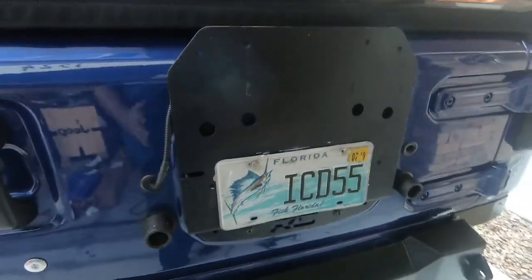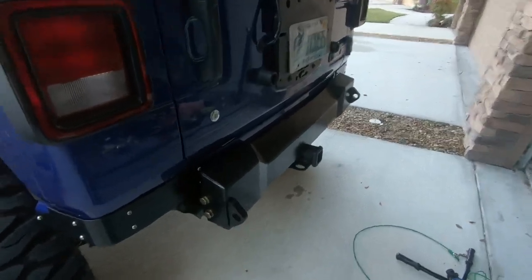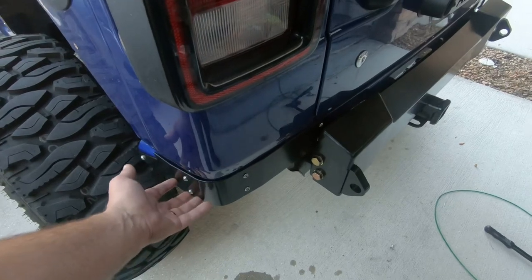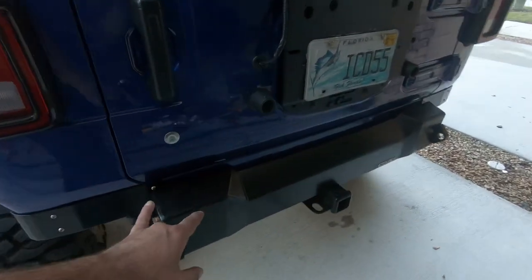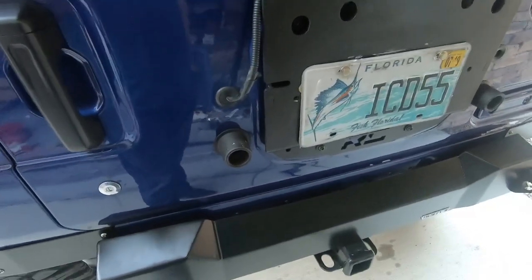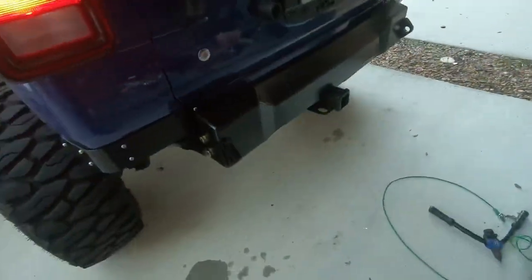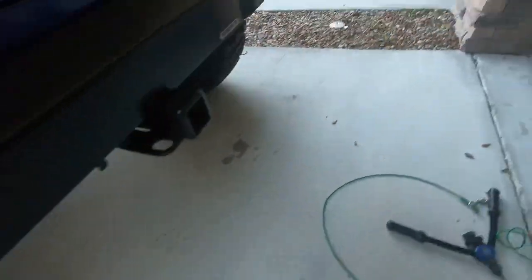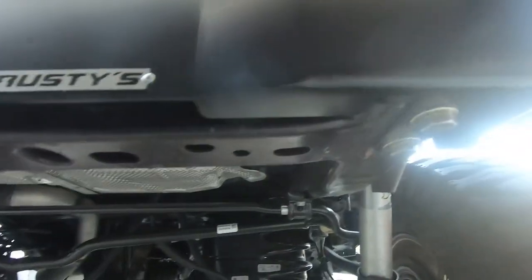For those going to ask about a camera — there's no camera right now. If you're doing this install, make sure you have two hands or someone to help support it while you pilot your holes, especially getting it lined up because there's nothing to hold it — it's just a flat piece. You'll need rivnuts for the three holes on the centerpiece; don't try to drill with just the nut that came with it because there's no way to get back there with a standard nut. For torque spec, pretty much just good and tight — don't over-torque though, because you can snap the inside welded nut off.